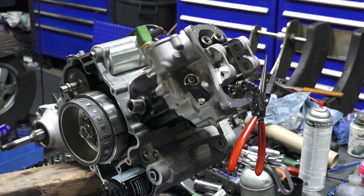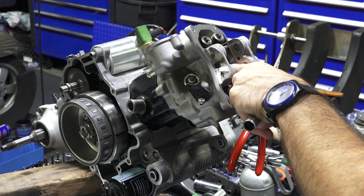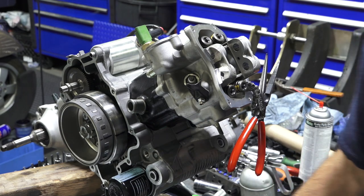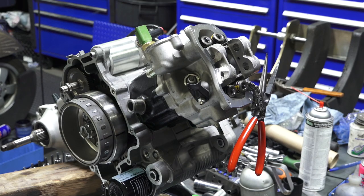One thing with the torque wrench, right when it clicks or indicates that you've hit the torque, stop turning, because you'll continue to torque even further, and that's not going to do you any good. So the next step is 270 degrees. You don't necessarily need to have an angle style torque wrench to do that. You could just do it with a regular socket.